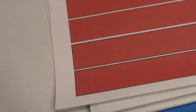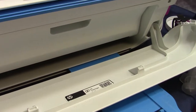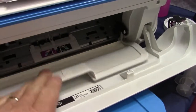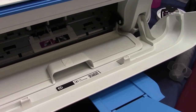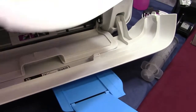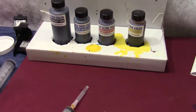Once the ink level drops completely, you'll never see that reading again. So depending on your printing schedule — once a week or once every two weeks — just add a little ink to the cartridge. If you keep adding ink, this cartridge will last hundreds if not thousands of copies. But if you keep letting it run out and it starts to streak, that's when you do damage. It's better to keep a little bit of ink in there at all times.